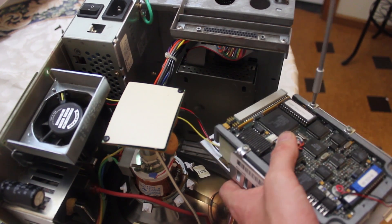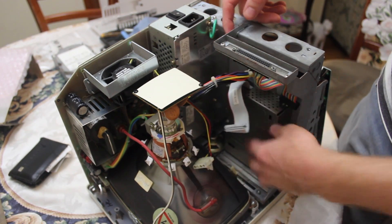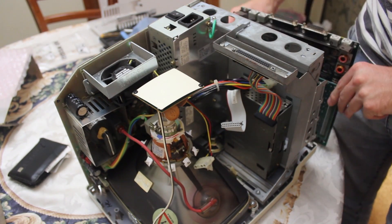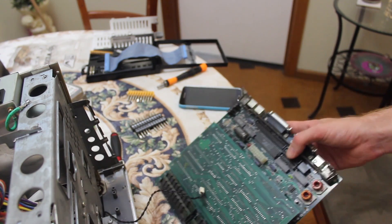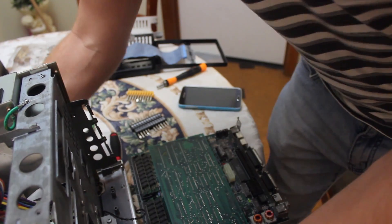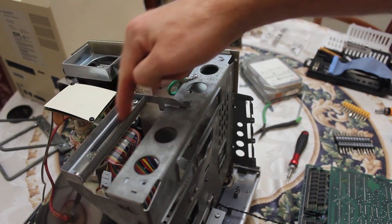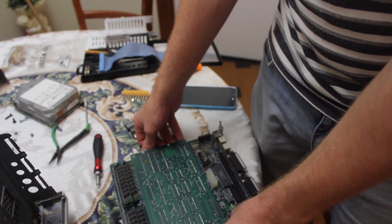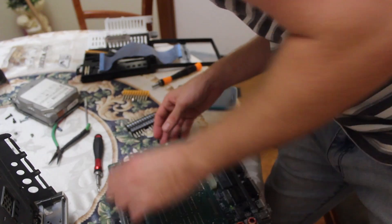Assuming I haven't already destroyed the main board by trying to yank it out. I was being an idiot — I forgot to unplug the power cable, so I took out the hard drive cage and got the hard drive. I was able to undo the power cable and slide the main board out. There's a trick for young players here: this cable connects to a front panel LED and will get you into trouble if you yank too fast. Just unclip that and we're ready to go. This might look a bit weird if you've seen an SE logic board before, because it's got this big expansion card. I believe, based on the rear panel connector — I think it's a 37-pin connector — it's a card for connecting a special Apple 5.25-inch disk drive.